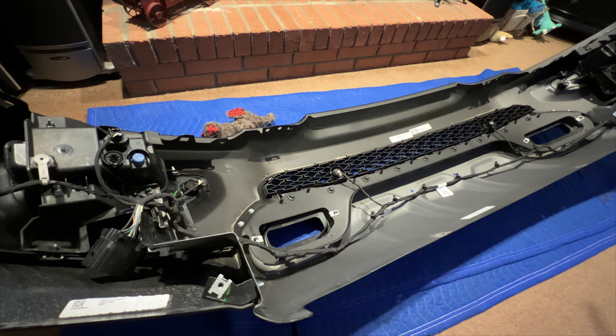With all the screws out, we should be able to go ahead and lift this metal part out and finagle it around. Once that's out, without the big metal part in there, we can go ahead and start taking out the rest of this stuff. You can see all the 13 millimeter bolts along here and these two 10 millimeters. We've got to take out all these bolts and then the skid plate part will basically drop right off.